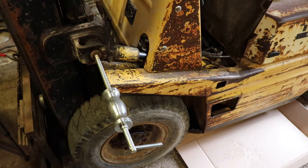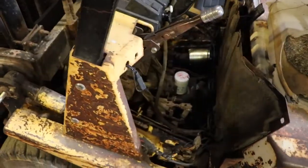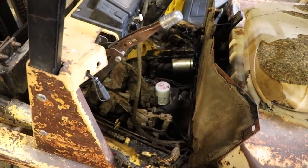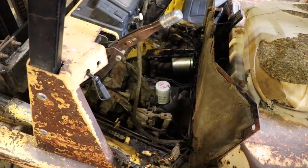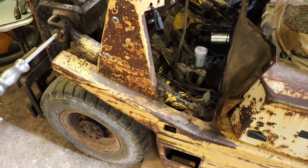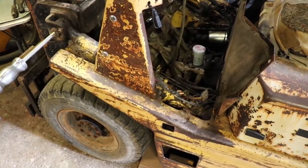I've started to clean things off a little bit, make it more tidy. If you look at the far side it's pretty nasty, so you want to try to do this as clean as possible. You might want to open the vent on your hydraulic tank if there's one, to see if there's any pressure in there - otherwise that could give you a surprise. I think I've got enough workspace to do this job, so I guess we will start pulling it apart.